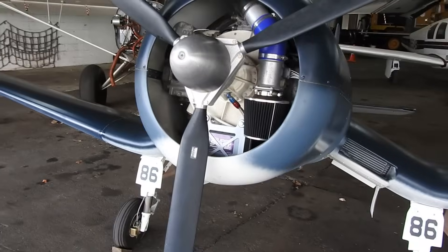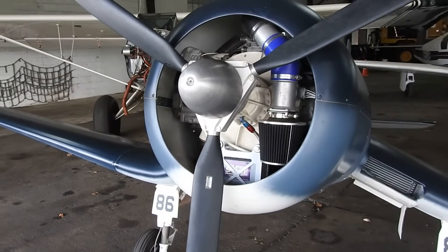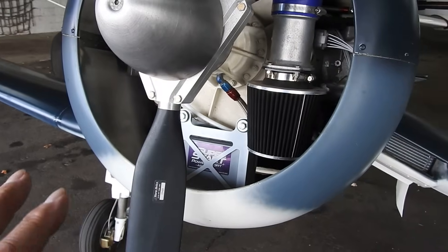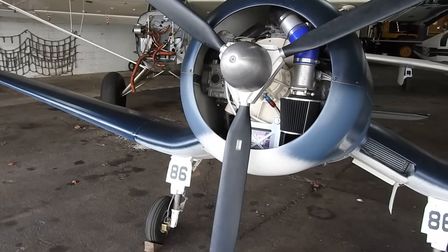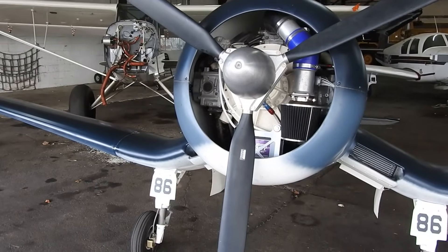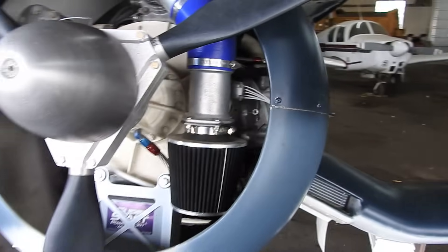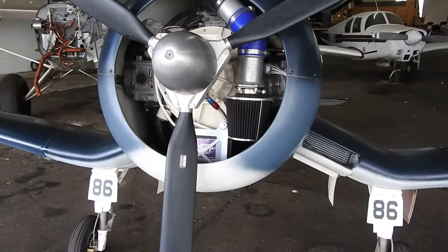I had that same problem when I was tuning Fox body Mustangs — the '86 to '93s and '94s and '95s. People will throw a filter like this on there, and then when the electric fans or the engine fan starts hitting air under that, it screws up that meter reading and it goes berserk. I'm pretty sure that's all it is. I ordered the shield the very night I made the video talking about my problem. It's coming out of California and it's only a $15 piece — stainless steel. When I get it I'm going to pop this off, pull this filter off, take it home with me so when I get the shield I can adjust it so it'll fit. That should take care of it.